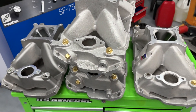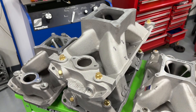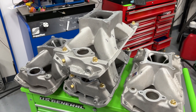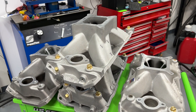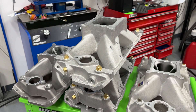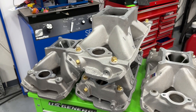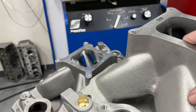Just to save some room — this Holley sucked on the four-barrel and it also sucked on the two-barrel. I'll show you the results so you can see how bad it was. It just wasn't good either way, and don't take that as a blanket statement because it could be this combination. Just to recap: it's a 400 small block Chevy, 11.2 compression ratio, AFR 195 Enforcer heads absolutely stock, an Erson cam at 260-270 duration with 690-ish lift and 108 lobe separation. That lobe is actually used on circle track stuff, but for whatever reason this intake manifold did not like that combination.